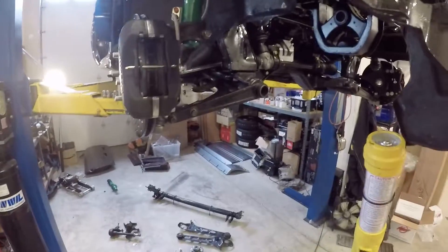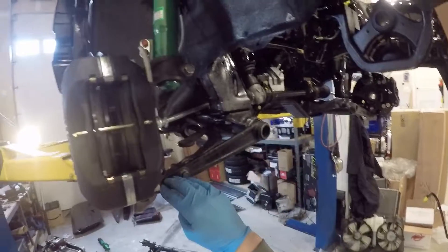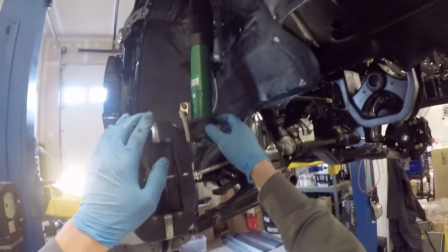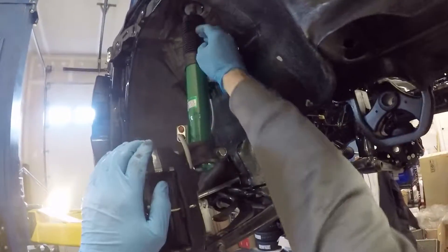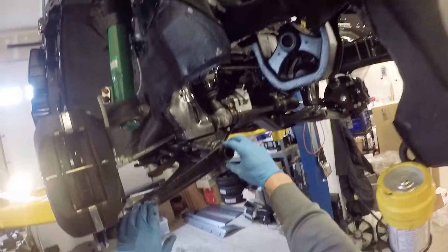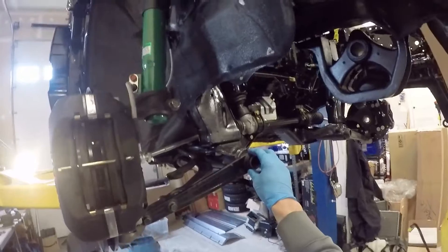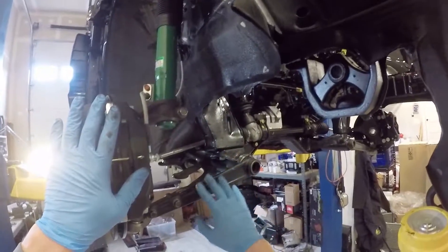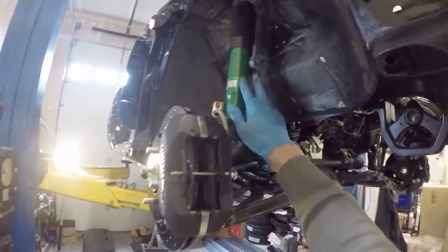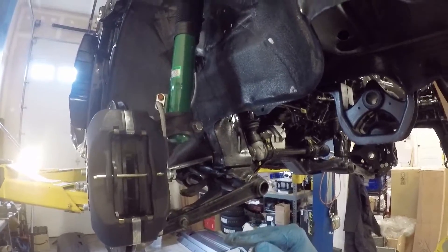What dictates that rotation is the angle of this arm, which is dictated by the height of your strut tube. The factory strut tubes are a little bit longer than these Medieval Pro ones, so from the factory setup you'd have a little more droop, which moves this orientation differently from where it sits now. When you go to install a short-stroke suspension like this Medieval Pro kit, you'll find that the arm has to move up a little bit in order to install everything correctly.